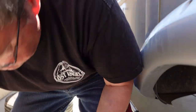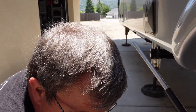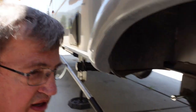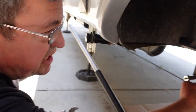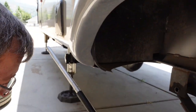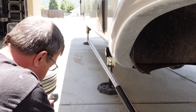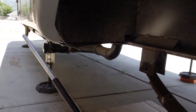This is an actual kit that I bought with these shackles. Now, if you don't have this type of system, either Mor/ryde or Road Armor, and you decide to put them in, make sure that you change out the plastic bushings on the inside of these leaf springs to a brass one. And that'll mean taking the leaf springs completely off and using a bench press.